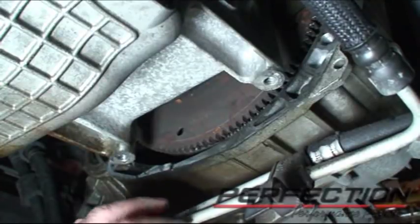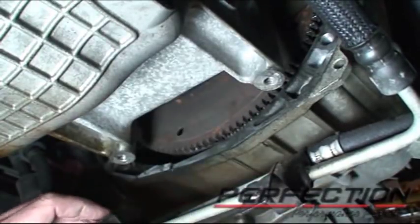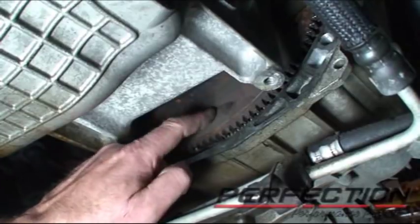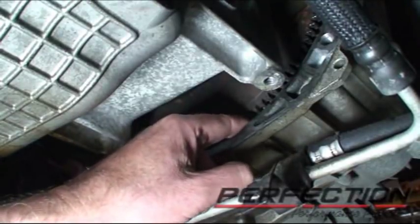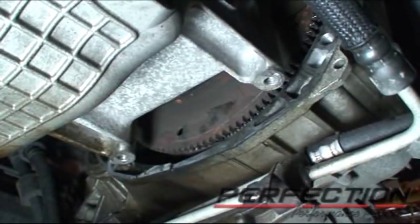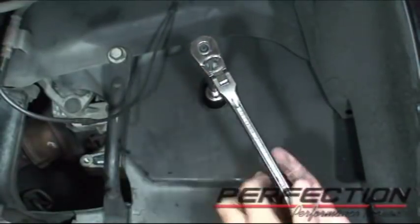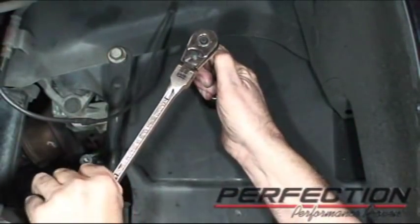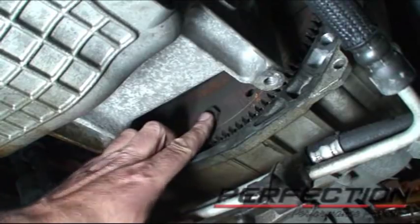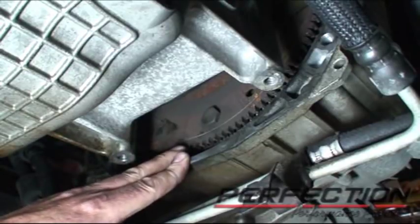Now we're looking at the bottom of the engine. I've removed a piece they actually call a structural collar, which holds part of the intercooler tubing and power steering hoses. This is actually a flex plate right here, and the modular clutch and dual-mass flywheel is attached to it. I want to take it off as one big piece. I'm going to rotate the engine — there's a little plug on the passenger side inner fender liner. I'll remove the bolt, take it out, rotate 90 degrees, bring up the next one, and continue until all four are removed.